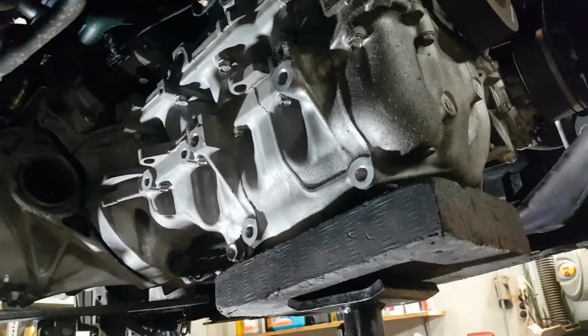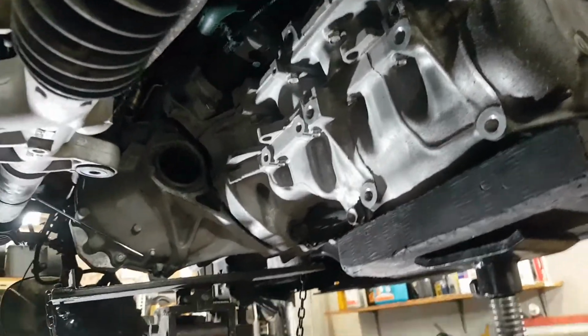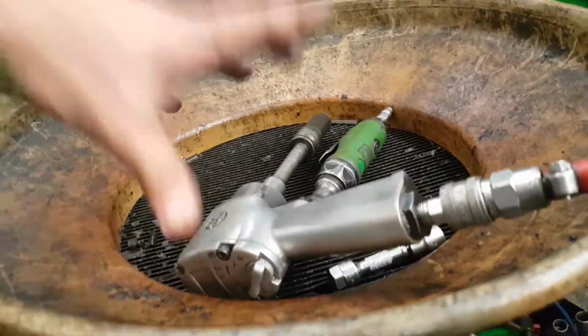Now, this car has got a lot of brilliant engineering aspects to it. As you can see, the rack is hanging here. It's secured by different numbered bolts here, and there. But you can get a compact air gun onto all of them if you do the job in the right fashion, right? Now, ABS sensor warning, very fragile. It's tied up there, protected.